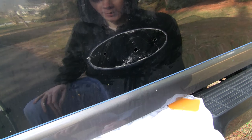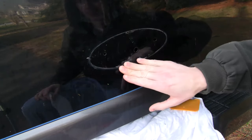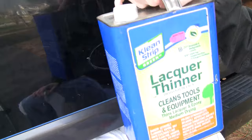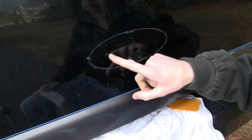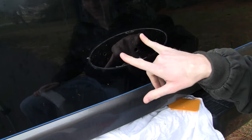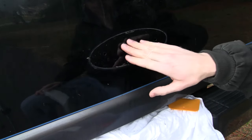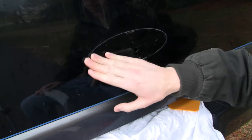I'm pretty happy with the way that turned out. I've got pretty much all of it — there's really not even any spots you can feel. There is a little bit of residue around the edge, and I'm not even sure if that's actual adhesive residue or just dirt. Either way, I'm going to use a little lacquer thinner to clean all the dirt and grime off. Just keep in mind with lacquer thinner — depending on the paint it can take the paint off. I've used it on this truck before without problems. Just be mindful, stay inside where the adhesive is going to go, and get any dirt, grime, or grease off that would prevent it from sticking.